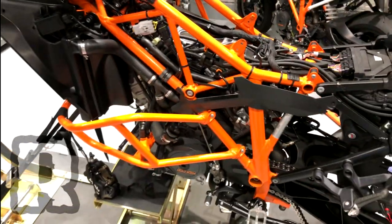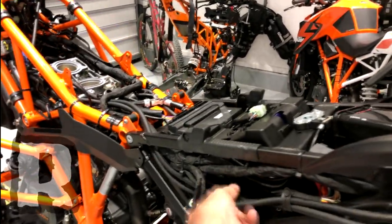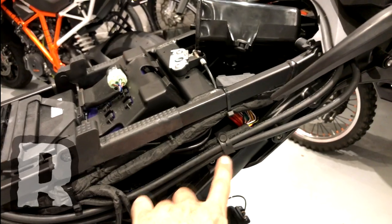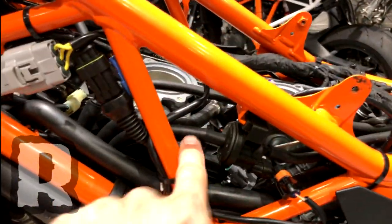That's really all there is to the canister system on the 1290 Adventure. There's a lot of weight to be reduced when removing that — these hoses are not exactly lightweight and there's a mile of them. A lot of people just want to use this space back here for tools; it opens up a ton of space. This all comes out pretty easily. You don't have to take off the side pod — you can just pop the tubes off and draw them through. There is a little rubber strap right here that might give you a hard time, so if you want to pop the side pod off and pop that off, it'll free those up and they'll pull right through. Cap this guy, put the dongle there, and run the right-hand line down to the side of the engine. It's that simple — there's nothing else you're missing.